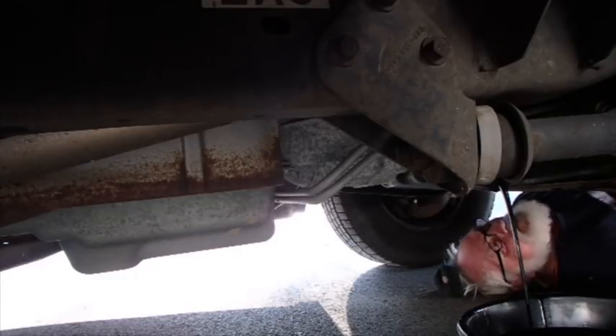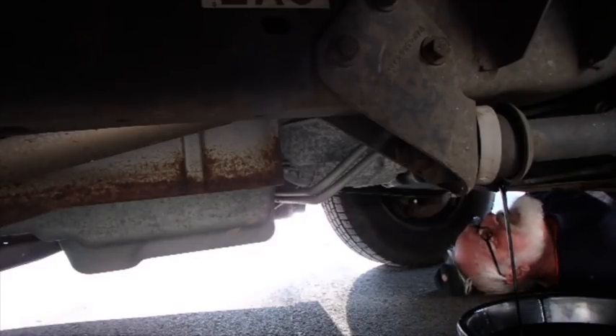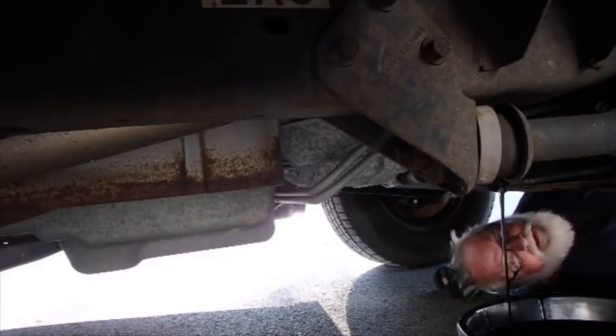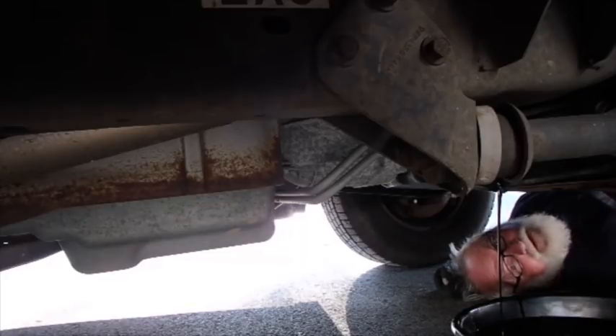All I'm going to do here is just let the oil drain out of this baby. As soon as she stops, I'll put the plug right back in there, tighten it up, then pop this filter off, put the new one on, and pour five quarts of fresh new oil down in the motor — and that'll be done. Next thing after that, I'm going to get a water sprinkler and put it underneath this thing, let it blow water from underneath to wash off the undersides from where it was driven on the snowy, salted roads recently.